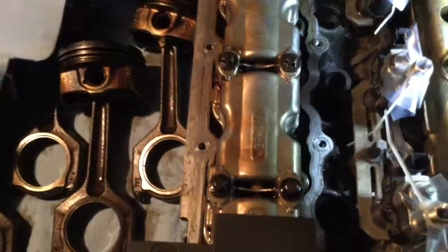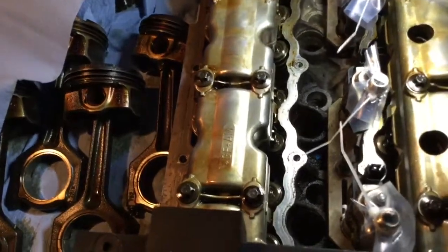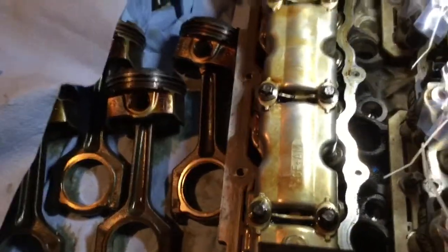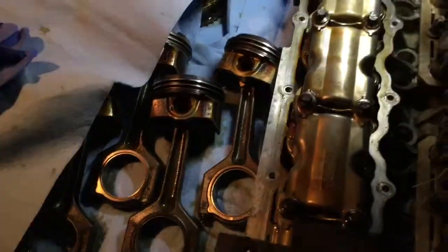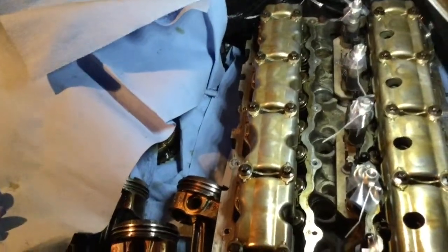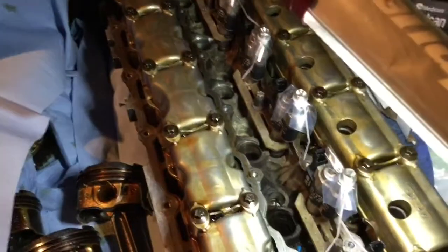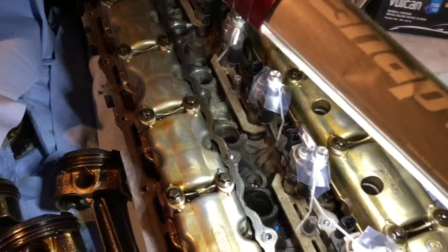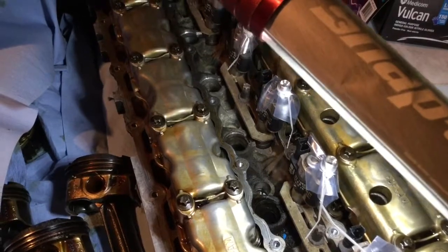The idea is, this jig's sole purpose is to withhold the cams that have been depressed at the moment. So it's gonna relieve stress from the cams, so then we can remove all of these screws around on one side. It's the same principle. We start from the outside on each end in alternates, going toward the middle. That's the idea to proceed with that. So right now I'm gonna remove the two brackets with the first four injectors, and then I'm gonna install the jig and show you how it works.